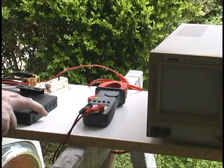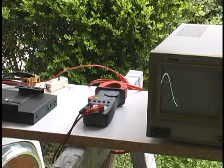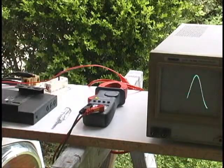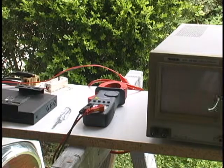I'm going to unplug this and plug it into the right output, and you'll see the signal should look roughly about the same. This unit also has a full-range front left and right output — in case you only had one set of channels coming off your head unit. You could run your sub off the low output channels and then run the full-range output for the remaining system.